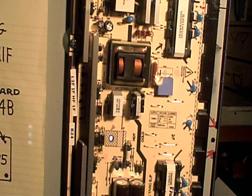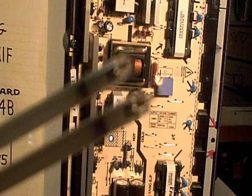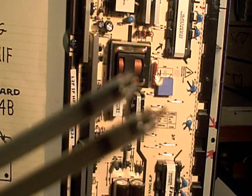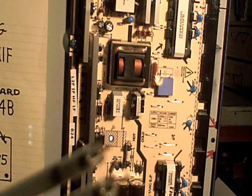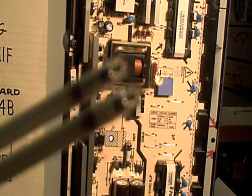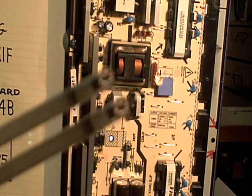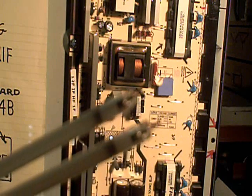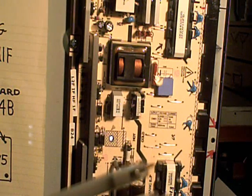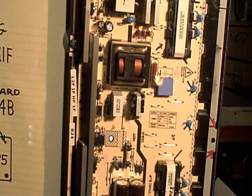A friend in the business mentioned that one time they were working on an older LCD TV and put a brand new remanufactured inverter board in — it worked for a few seconds and quit. He replaced the driver transistors, got it going, and it came on for a few more seconds and quit again. He concluded it was the older lamps causing the inverter board to work too hard, making it go into shutdown altogether.